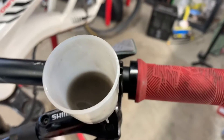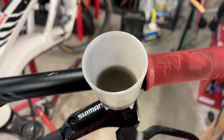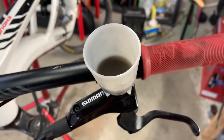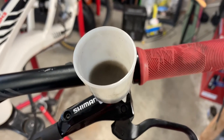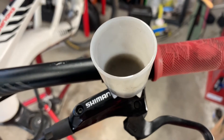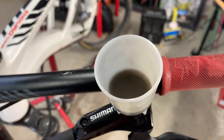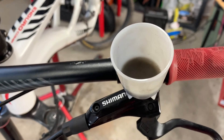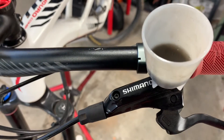Notice the difference in color — pink, clear, translucent pink line versus nasty gray. That gray is actually a result of pressure and heat, the two things the brake is exposed to. This is why we bleed it. This darkening is a natural phenomenon associated with hydraulic oils, and Shimano brakes are among the worst culprits for this kind of fluid darkening.